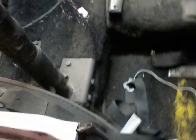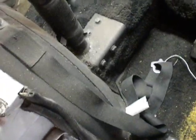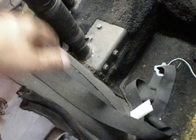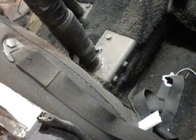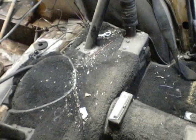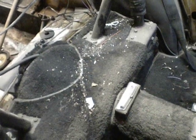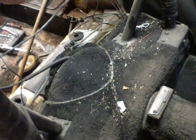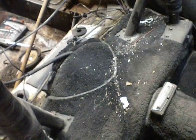I'm still working on the interior. Got the seats out. One thing I've got to decide about is this roll bar — it's just attached into the sheet metal. I mean, if it really were to be a roll bar it should go to the frame. So I'm going to disconnect that and decide if I want to have a roll bar with holes in the back going to the frame or not. A crossbar bridge may come into it.